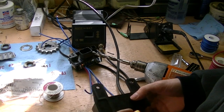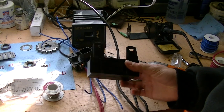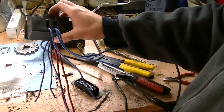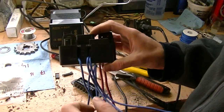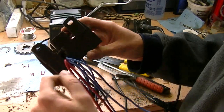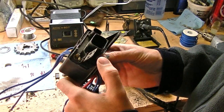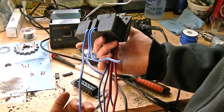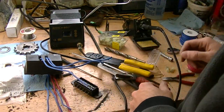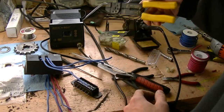Now that we have affixed all the wires to the glow plug relay, I'm going to drill a couple of holes in the shell to allow them to exit. After screwing around, slots ended up being the better way to go — couldn't get the wires out otherwise. I'll silicone all around this and make it watertight afterwards; it's under the hood so it shouldn't be too much of an issue. I also did all six, even though one is not used, just in case I got the wrong one or need to use it later.